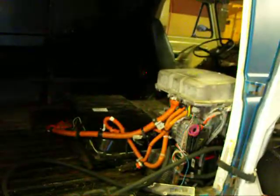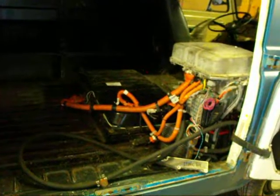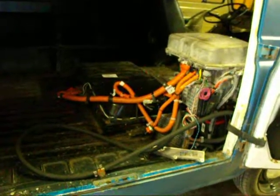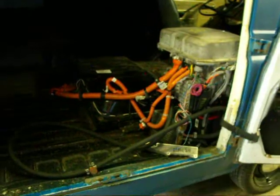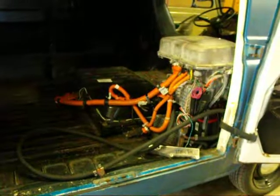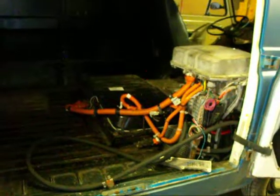Here is the piece I cut off the van — 19k024 — and the inverter is also 19k024, so I have the matching inverter and motor together. It runs smoother, it definitely runs smoother. I took it up the street and back just now. I'm down to 10% charge according to my pack sniffer so I can't do a lot of miles, but I took it up and down the block and at a cruise trying to maintain speed — not accelerating, just maintaining — and there's way less rear-end rattle. Having the right controller and the right motor together seems to have made quite a difference.